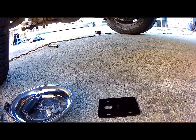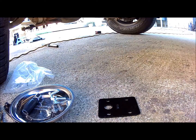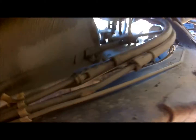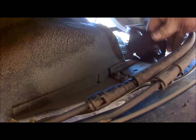You're going to need to drop your transmission linkage mount. To do that, use the provided bracket in the package. Mount the two top holes to the original holes on the frame, and then the bottom of the bracket — which has three holes — becomes your new mount for the transmission linkage.